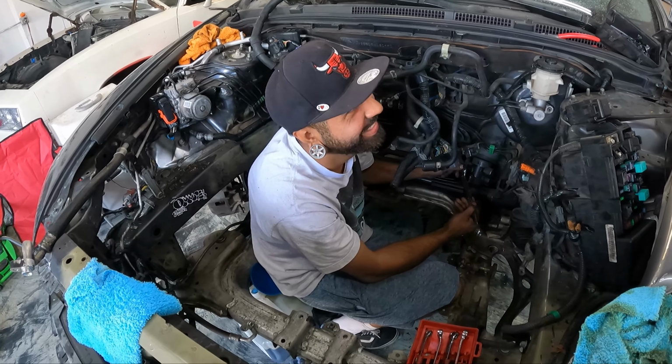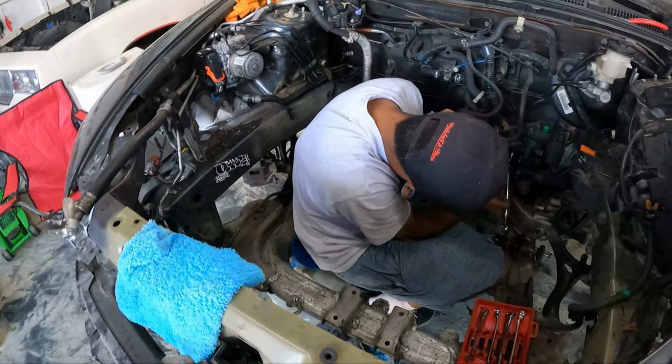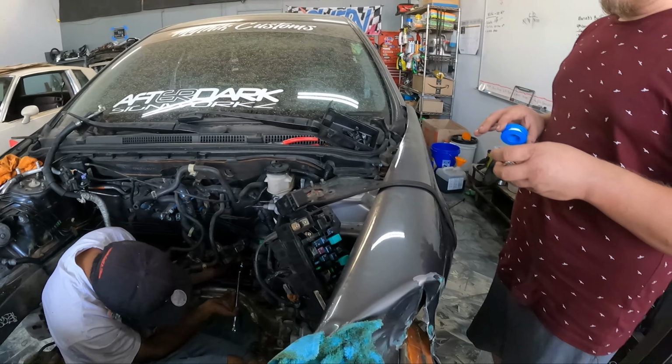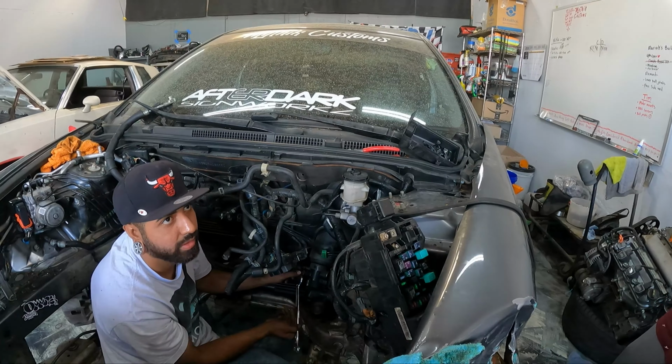You know how it works? So basically the same thing. It took you 45 minutes to take the motor out, 30 minutes to take the rack out. That's an hour. It takes about almost 4 hours to take the rack out on the floor. The computer says, on the floor, it's probably more than that. Because on the computer, it calls for 4 hours to remove the rack. That's why I haven't done mine.